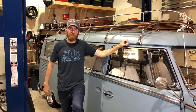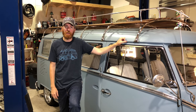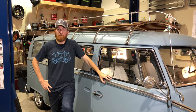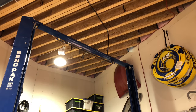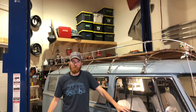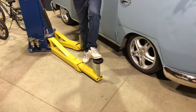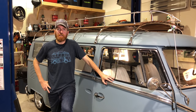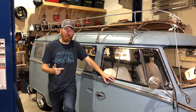As far as working on a vehicle, the two-post is preferred. For just storing a vehicle, the four post is definitely a great option. The major consideration for your garage is height. When we built this garage, height was planned for — we knew a hoist would be going in, and we even put thicker concrete in the areas where we knew the posts were going. The two-post was always the plan; the four post was kind of an afterthought as more vehicles came into the garage.